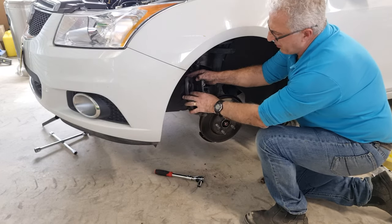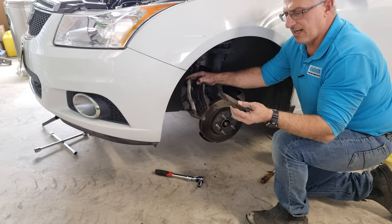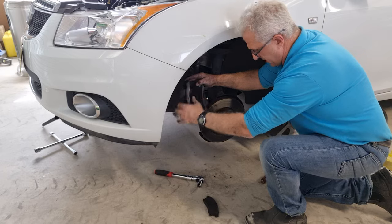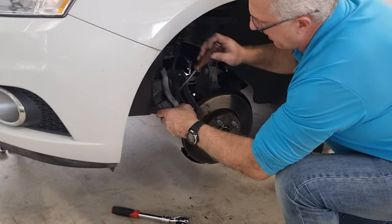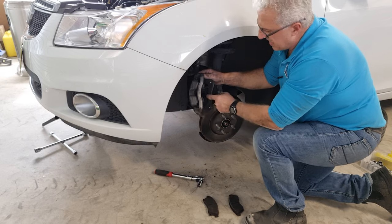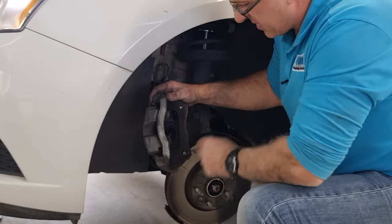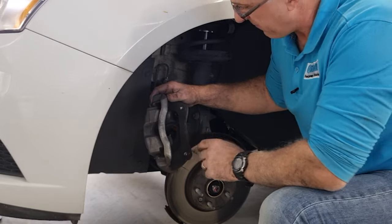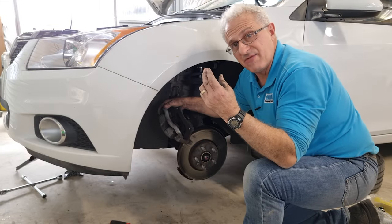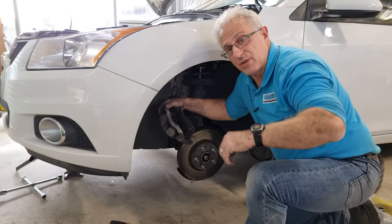This is the caliper, and the brake pads are sitting just in here like this. There's still plenty of meat on these ones, so I'll keep these for the future. Just here is the piston. What we basically have to do is push this piston back so we can put the new pads in. We need enough room — this cylinder is sitting out probably about 10mm. When you push it back, it's got to be pushed back evenly. If you push it on one side only, it will jam the piston, so be careful not to do that.